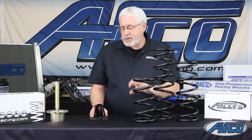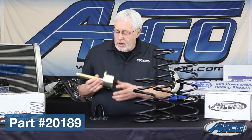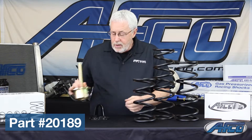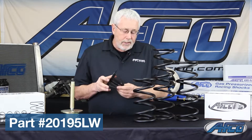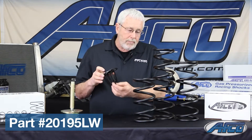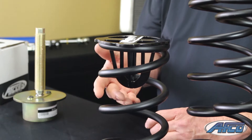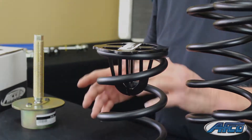Some of the other features we have for the springs — we've got different types of spring cups. We have the swivel mount spring cup that works pretty good on the rear or on the left hand side of the car. AFCO also offers a spring cup like this where the weight jack bolt goes down through the middle, and when it's on the car you actually change your spring table so you're pushing down more in the middle of the spring so you don't get spring bow. And actually on the right side of the car this will give you a lot more feel.